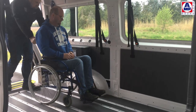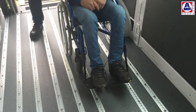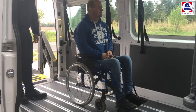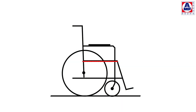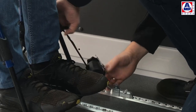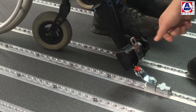The wheelchair needs to be positioned between the tie-down points on the vehicle floor, facing forward. Here we are using the example of longitudinal rails. Note that the tie-down position on the wheelchair needs to be at the height of the seat. Only fix the belts on the stable frame of the wheelchair. The retractors need to be tightened firmly, as a loose belt reduces the safety features dramatically.